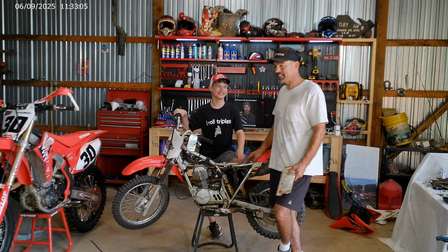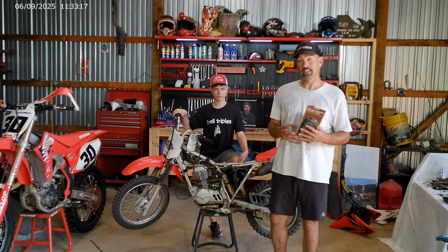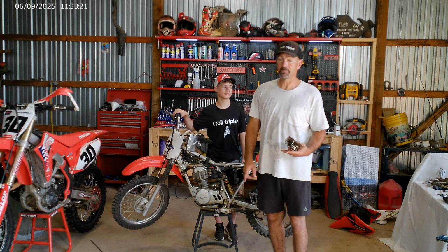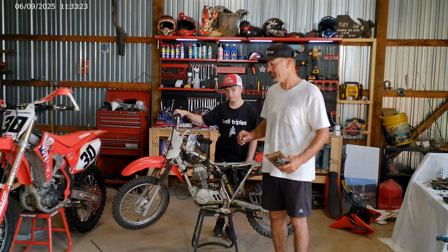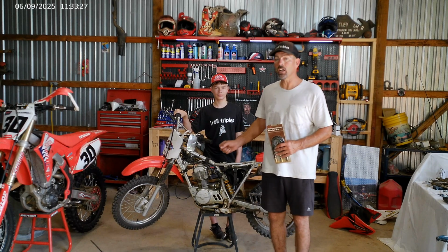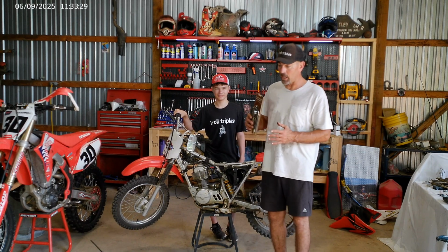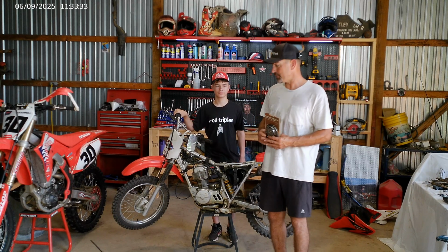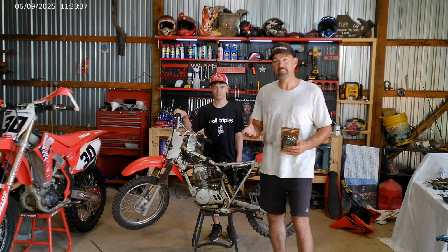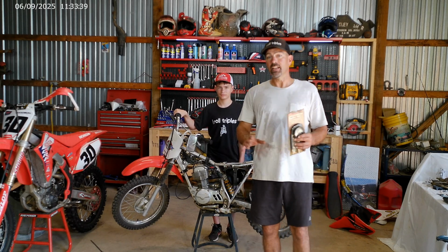It stalled. That's correct. So with those symptoms, and like I said, it's a different issue if you don't have fuel, air, or spark. You definitely need to do some other troubleshooting from there. But if you've got all of those bases figured out and the only thing left is compression, and you can't check the compression gauge, if you can get somebody to pull you and it gets going, what happens is that piston in there is worn out.